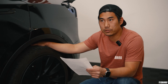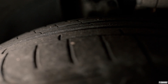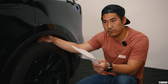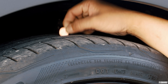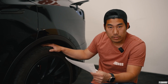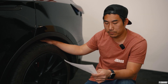Sometimes you'll get uneven tire wear. When you check your tire treads, the outer area might have a very deep groove while the inner tread is super thin. These cars are really heavy and can wear more on the inside, which is quite dangerous. If you notice inner tire wear, ask service to check your alignment — that's something you can bring up with them.